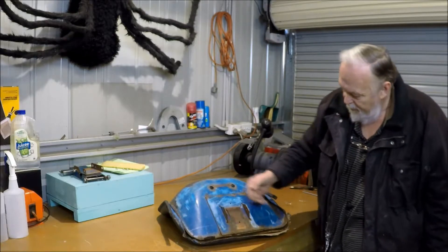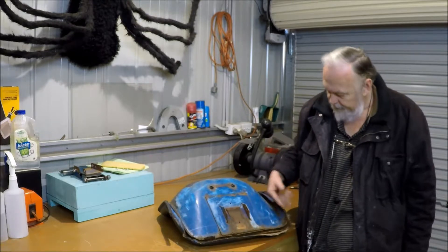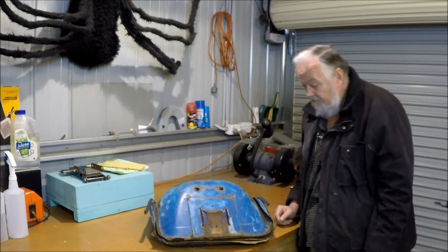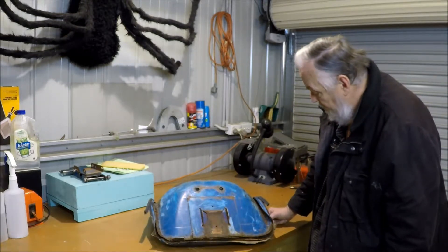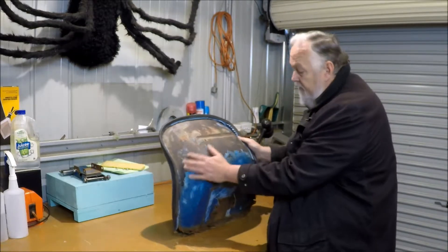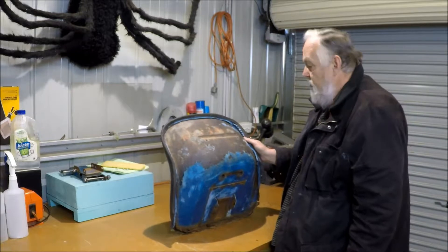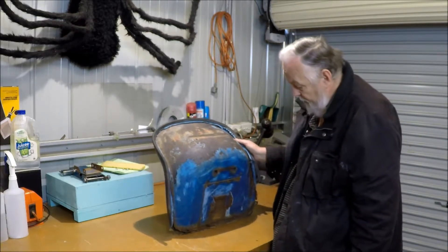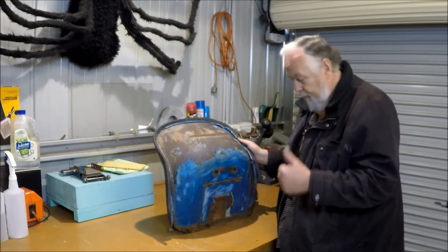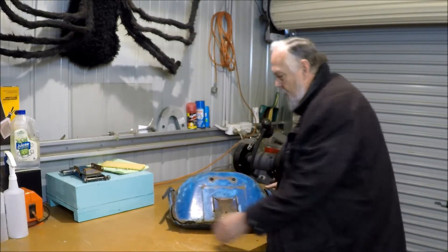Once I've done that, I can mark out exactly where that edge is supposed to finish at this height, trim it off with the tin snips, and basically that's it — it'll be repaired. The rest of this we can hit with some sort of reducer if we want, phosphoric acid base perhaps. Otherwise, we can use one of those self-reducing enamels, which are very handy and come in Ford blue or very close to Ford blue. Okay, let's get started.